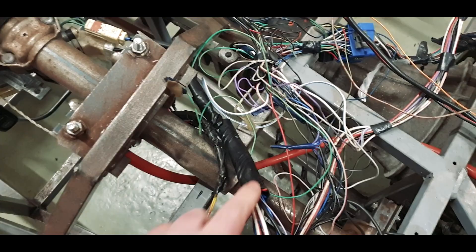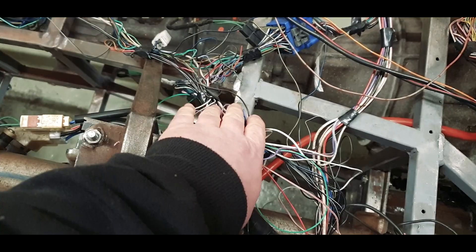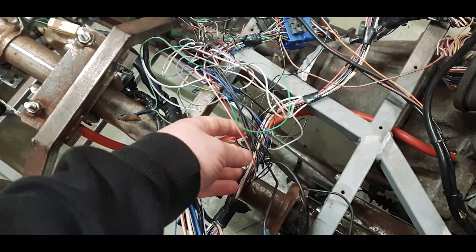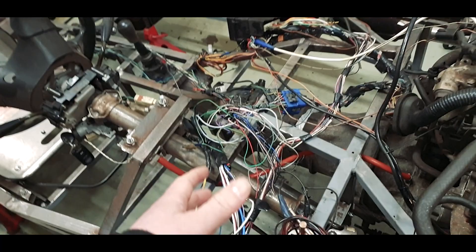I've left wired onto that the ignition loom, and from the ignition loom we've got a small number of wires going to the ECU. I think we're kind of getting close to a point where this is all the wiring we need. We're going to untangle a lot of this and whatever needs to remain gets lengthened accordingly so that it just takes a smarter route.